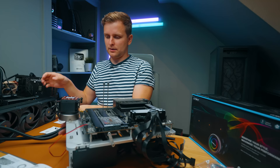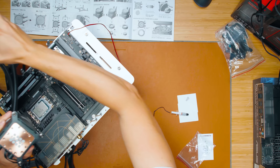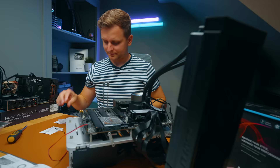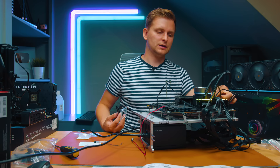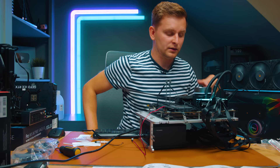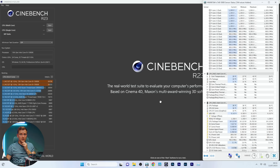The pump block is very heavy. Line it up carefully and make sure the bracket has no gaps on either side. There are also RGB connectors on the sides — one connects directly to the motherboard RGB header and the other lets you daisy-chain additional RGB connectors. The pump is connected to the pump header so it runs at 100% speed at all times, and you can faintly hear it, but it's not too bad.